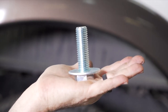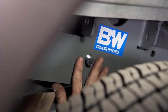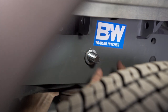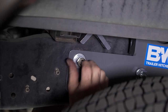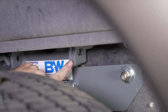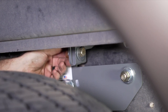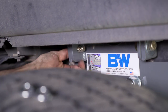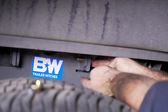We are now ready to install the passenger side plate. We will use another 3/4-inch bolt, but we will use a standard 3/4-inch flat washer. Now position the cross members and align the holes, passing a half-inch bolt and flat washer from the rear forward. Now position the forward-most cross member and pass the half-inch hardware and flat washer from the front of the truck to the rear. Repeat these steps for the passenger side.